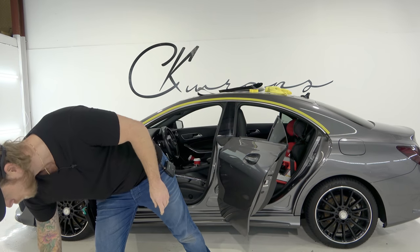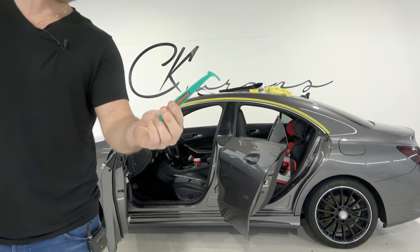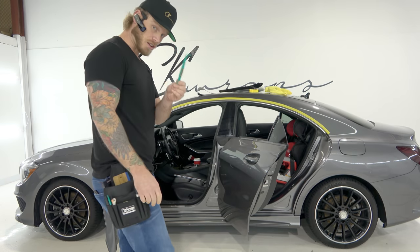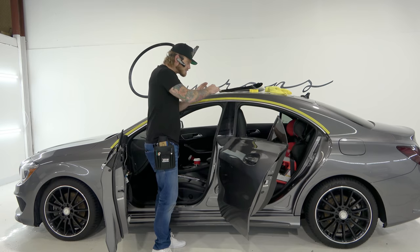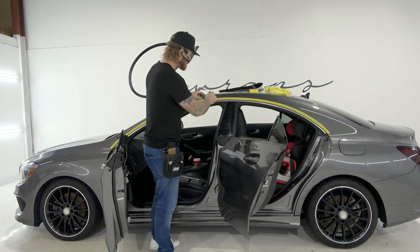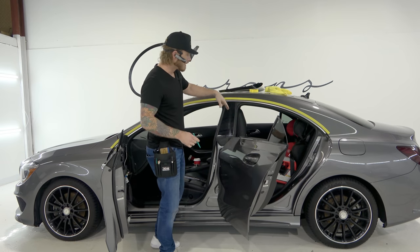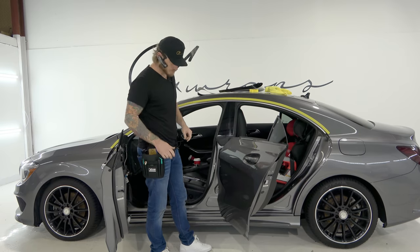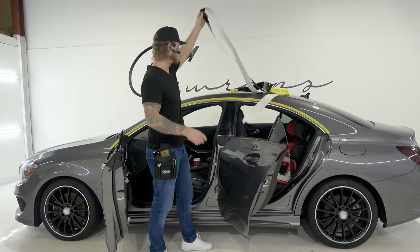The other tool you probably want is some kind of tucking tool. This little tool right here is called the Wrapstick Flex by Sign Maker Tools. This is a fantastic little tool and I'm going to be using it a lot during this chrome trim delete because it's just that good at what it does. It's great for tucking in the edges, getting really close to this rubber seal down here — you're going to see me use it on the lower trims and this upper trim right here.